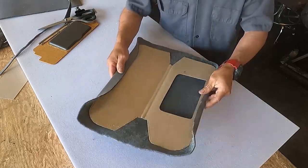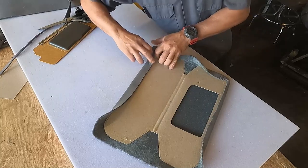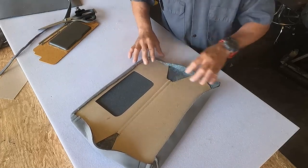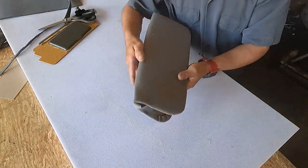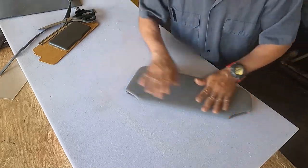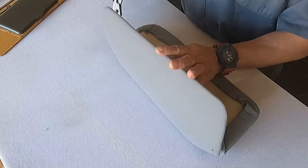Just make sure when you put the material, pull it evenly, or you will see a bubble or bump on the other side — and believe me, you don't want that. I just fold it and I will make a cut on one of those sides, because part of the sun visor will go through one of those sides. I cut it, then cut a little bit more.